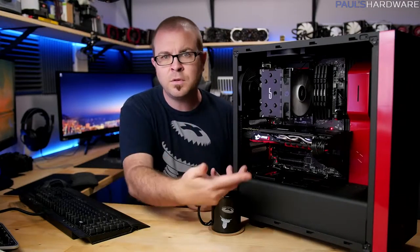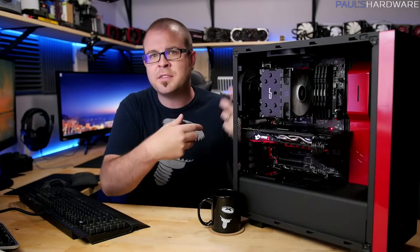Of course, I already mentioned the potential SLI snafu with this build, but if you were going, for instance, dual 480s, for example, or you did upgrade that motherboard to the M5 version and you did go SLI, you would want a bit of extra power available, and then you wouldn't have to swap out the entire PSU and all that kind of thing. That said, just make sure you get something quality. Make sure you get something that's well-reviewed. Johnny Guru, Tech Power Up, really good reviews for power supplies.